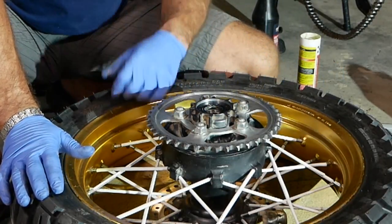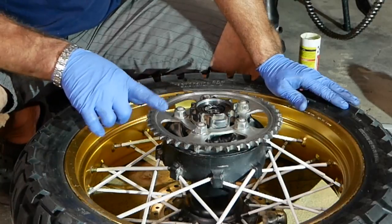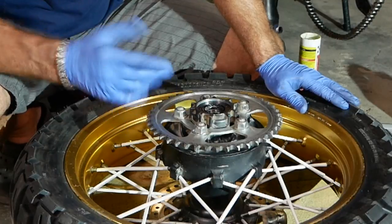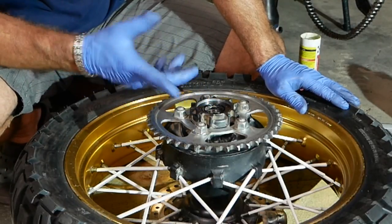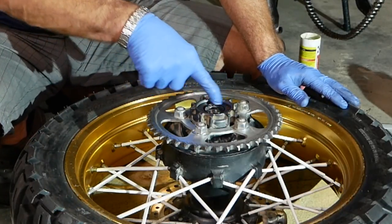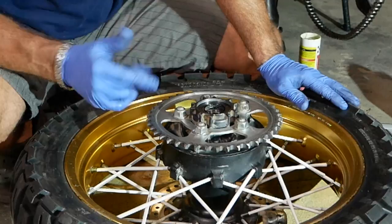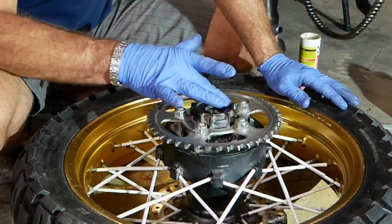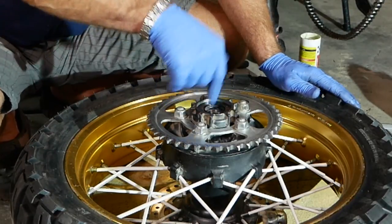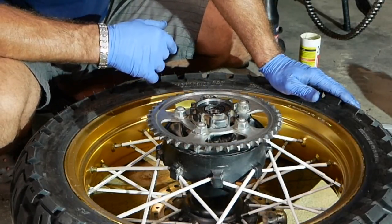As you saw in the pictures, the bearings were toast. Check those bearings often. I would recommend even pulling up the dust seals to have a look at what's happening inside, then just replacing the dust seal — because once you pull it out, it's supposed to be changed. About 90% of the time it's going to be damaged. In my case they came out pretty easy, but sometimes they get stuck and there's nothing you can do but replace the dust seal. You don't want to end up like me in a pretty serious situation on the way back home.